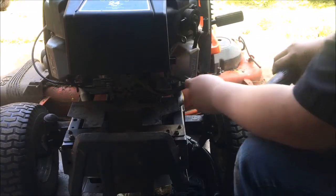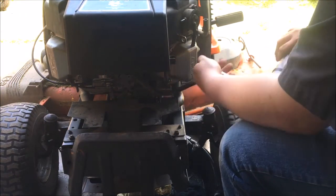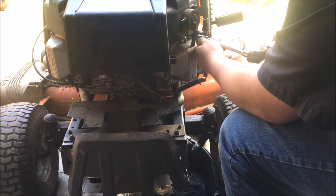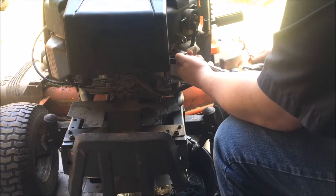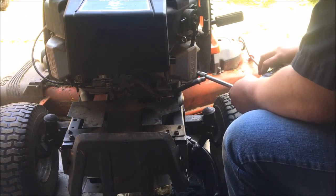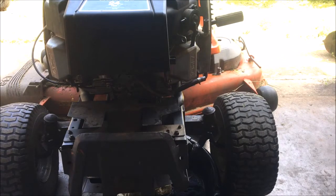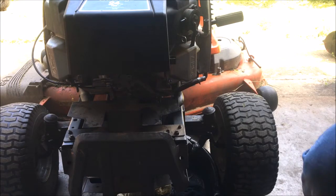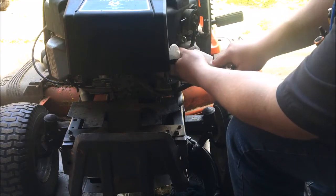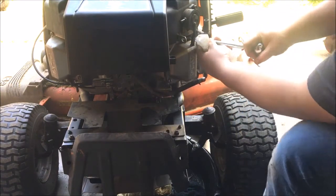Don't always work the way I need it to, but you want to get these run up slow. Now all I'm doing with this is just running it up. Not going to use this to tighten it. Tighten it by hand. Always run them up snug. I'm not tightening it with a ratchet. I'm going to tighten it all by hand. I just wanted to run them up with the ratchet so that I could get them all run up quick enough for it to set up. I'm going to come back with the ratchet and finish snugging them all down.